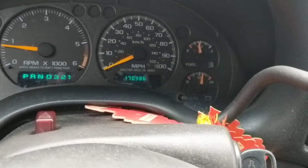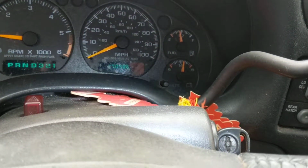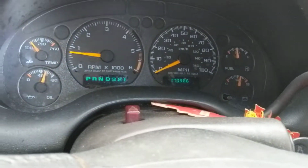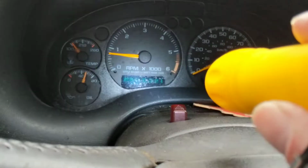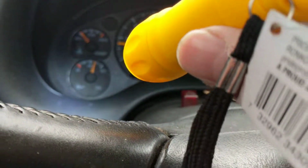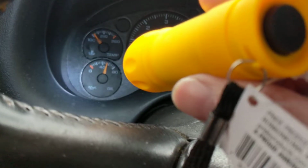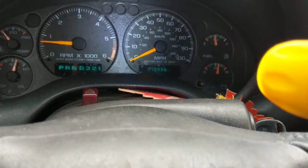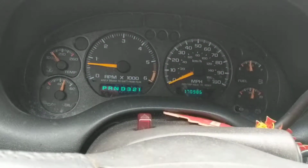And like I said, the volts over here is around 14, and that'll come down also. Normal is everything in the middle. This should be in the middle. Coolant temperature gauge should be in the middle. This should be around, like I said, 20 psi at idle, and this will go down. So therefore, normal is that.